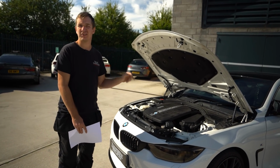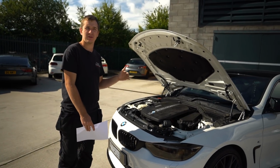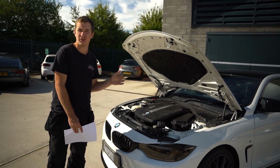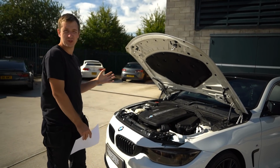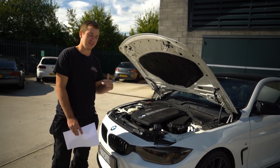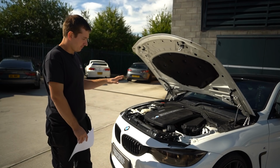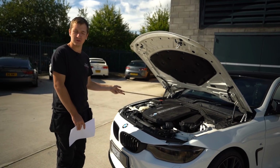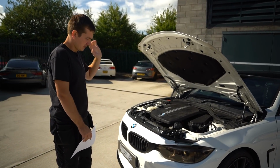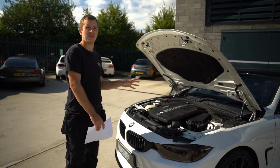So last time we did the video, we were at 401 horsepower and we're right on the edge of the injectors, and we thought right on the edge of the pump as well, which we usually are with most stuff like this. Then we went on the road and it was getting a bit hot, so we turned it down a little bit. The spec to get to that horsepower was the 28 turbo, intercooler, exhaust downpipe, all that sort of stuff.